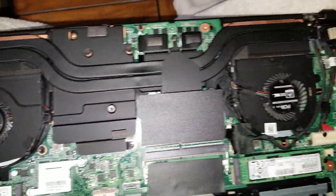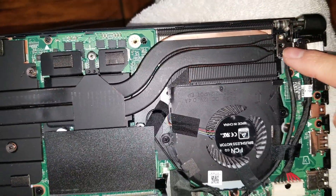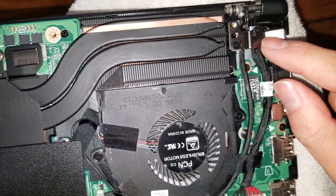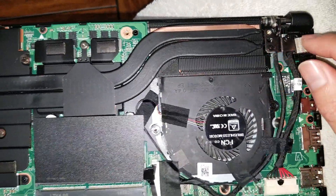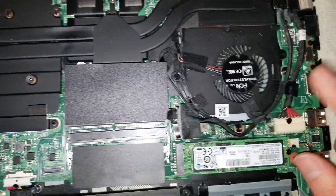It's pretty simple overall. To remove the LCD on this one, you actually have to take the whole screen out, because the way it's built the base gets in the way. You'd have to open the screen to 90 degrees, then take those screws out, and make sure to disconnect the Wi-Fi connectors and the LCD connector.